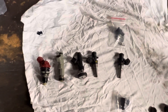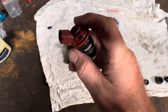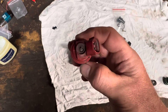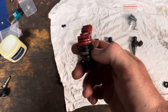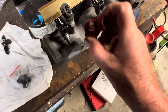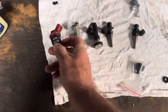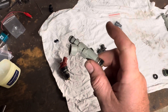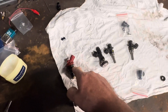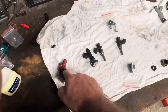If you don't know much about injectors like I didn't once upon a time — these are actually for a Subaru but they're very similar to non-VVTI 1JZ injectors. These are side feed basically; the fuel goes in here and they sit in a rail with a circular mount. That's what non-VVTI has. These are factory VVTI injectors.